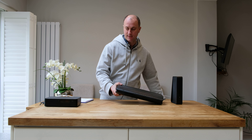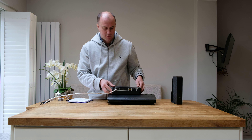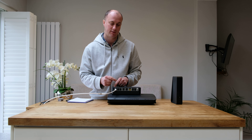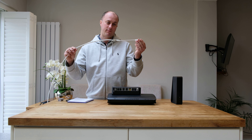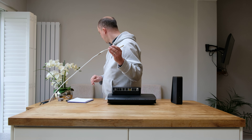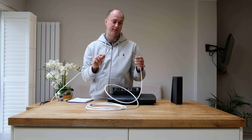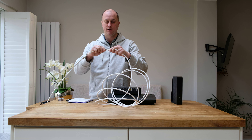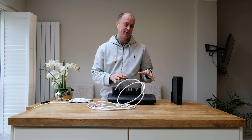So it's as quickly and easily as that. With the V6 box it's slightly different. If you look at the back of the V6 box here, what you'll notice is Virgin engineers will often put a patch lead here, because the connection is different — it's actually an RF input rather than an F connection. So where you've got the short patch lead, that's actually coming from your existing line coming into your property to the actual adapter here. All you need to do is just keep the adapter on there — don't touch it at all, just leave it as it is. Then we send you the V6 version cable, which is a male RF to female RF cable. All you do is attach the female end to the one you've just unplugged, attach it there, just push it in, and then just reattach the back there again.